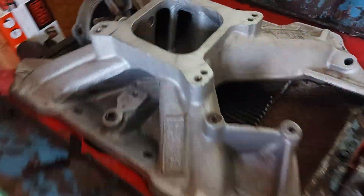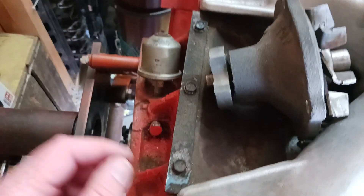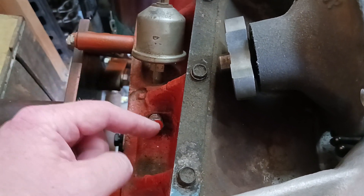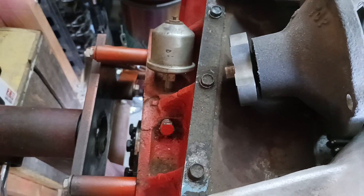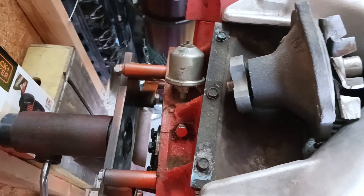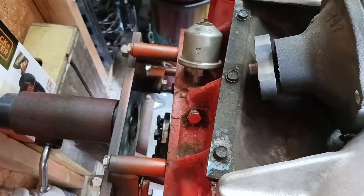The next thing you have to do is get oil to the gauge. The back of your engine has a factory sending unit, and there's two types: there's one for the kind of car that has a gauge, and a black ceramic one for the kind of car that has an idiot light. You can plug into either side — the factory normally uses one side, but it doesn't matter. Or you can do like I did and use both of them. I left my idiot light hooked up and then hooked up to the other side. You could also put a T here and run two off one. I left the idiot light intact because if I'm cruising down the road in la la land, I really don't look down at the gauges — that idiot light would pop on and get my attention if there's a problem. But I wanted the pressure gauge with the readout because I wanted to know what my oil pressure is when I have a cold engine.